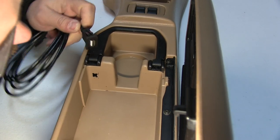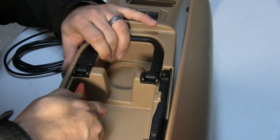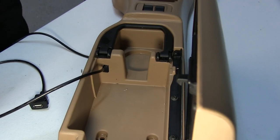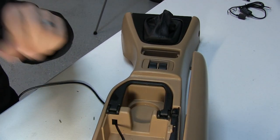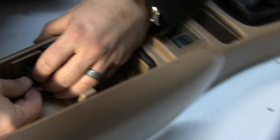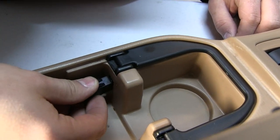As you can see, our hole is very small now compared to the size of what we need to get through it, so we'll just expand from this and keep making it bigger until we're just the right size. Once your hole is pretty close to what you need, go ahead and route the cable through and give it a test fit to get a general idea of how much further you need to go. We're probably at about 70%, so I can see we need to make the hole wider and slightly taller.